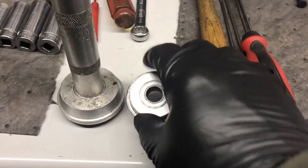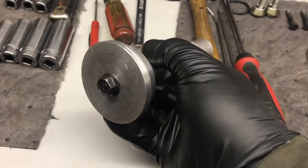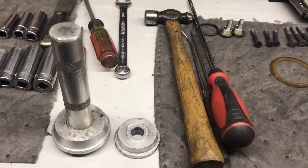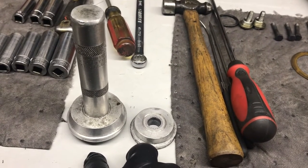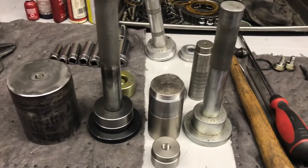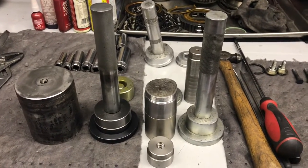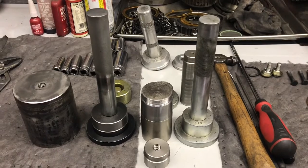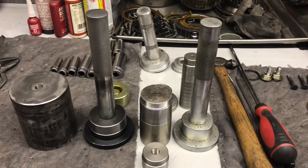Bushing drivers — at a minimum you're going to need a couple. This one fits my pump bushing so I can drive it right out, and this is what I reinstall it with; I can also put in the seals combined with my ball-peen hammer. The more bushings you have to change, the more apparent it becomes that you need different sized bushing drivers. Over the years I've made a bushing driver for just about every bushing I'll encounter. It's a must-have if you have to change a bushing, or you need to replace the part that has the bushing or find somebody who can help you. At minimum you have to change a pump bushing, and probably the tail housing.